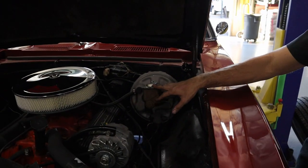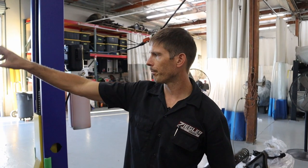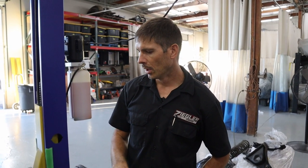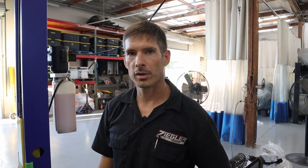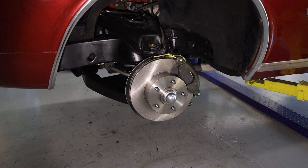We got the brakes all bled and finished up, but we're having a couple of problems. It seems like the master cylinder booster has some sort of issue — might be bad. On top of that, the passenger rear wheel cylinder seems plugged; you can hear the brakes applying but nothing comes out of the bleeder — probably rust or debris blocking the bleeder port. The front is bled really well with good pressure. Whatever the issue is, it seems to be the booster, the rear, or something back there — but the front seems fine. The front end turned out really nice.